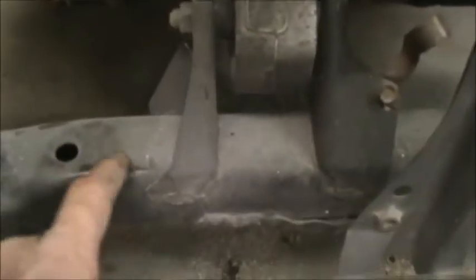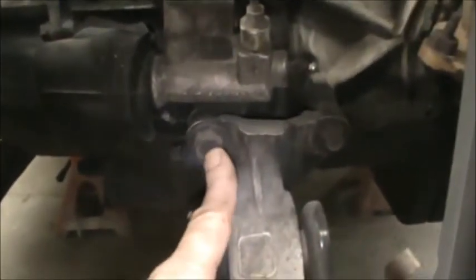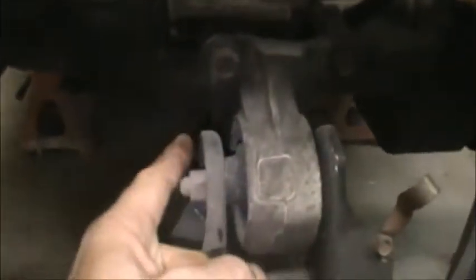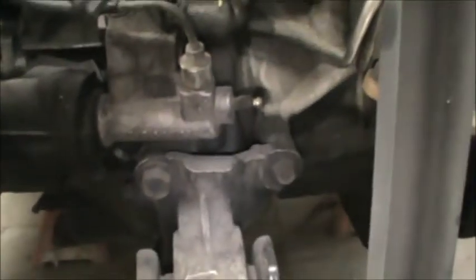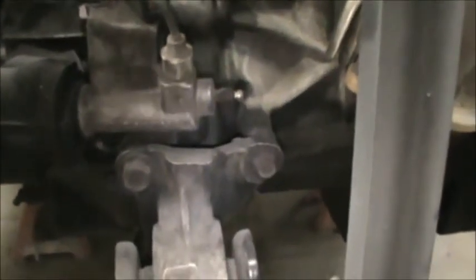Let's see if I can turn on the light. This is the front of the car, and this right here is the mount. This is our subframe right here — this is the mount for the transmission slash engine block. There's a screw here that goes into the transmission itself, and there's also one under here. And then we have this screw here, which is the block. So the block is being held by this mount as well.